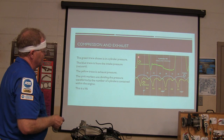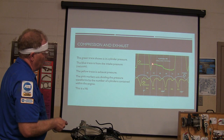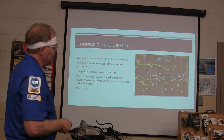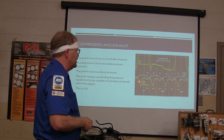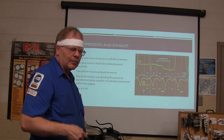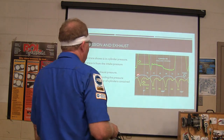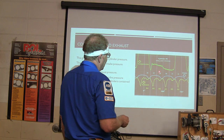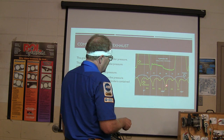Now, this right here — the green trace is your in-cylinder pressure. There's your compression going down, there's your exhaust starting to open. This is a six-cylinder. The firing order is 1-2-3-4-5-6, which it is on a lot of V6 engines. This is intake number three — we've got our pressure transducer reading compression in cylinder number three. That's intake three, exhaust four, intake four, exhaust five, intake five, exhaust six. This is your exhaust pulse using the sensor you put in the exhaust port, and this right here is measured in vacuum in the intake.